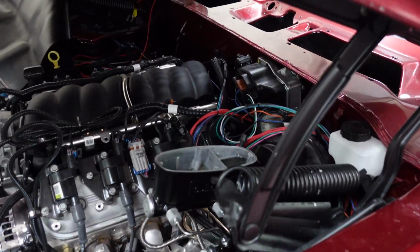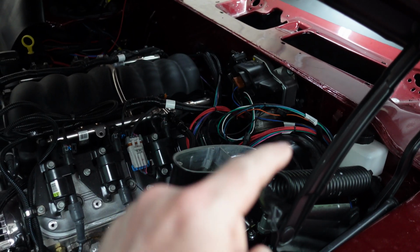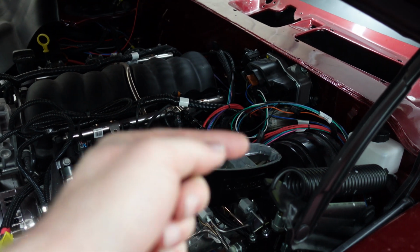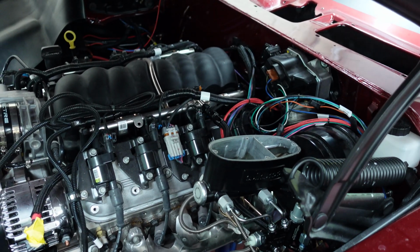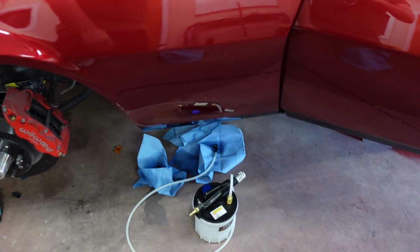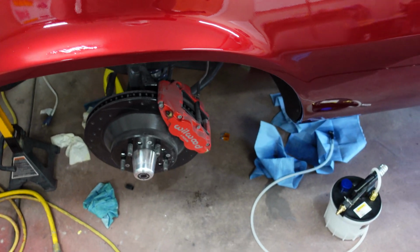All right, so a mixed bag. We've been out here working at this for a couple hours. The push rod was not missing from there. The power brake adapter had the little stub sticking out, which I thought would engage the master cylinder, but it didn't because the master cylinder's got a big bore in it. And then I remembered I did have this. It's not a push rod; it's basically an adapter that goes up inside there. So that was missing, so we put that on. That helped. And then we kept trying to bleed the brakes with this thing, and it just doesn't work. We've spent so much time with that. So we went back to old school bleeding, and we still have air in the lines, but that pretty much covered it. So we have brakes on all four wheels now.